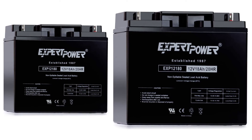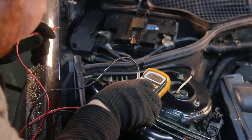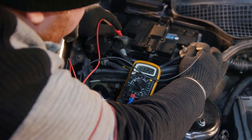If you want to monitor the battery voltage while riding, you can set a small LED voltmeter. For better battery service, don't discharge fully and keep them charged. Also, don't forget to charge them every 3 months if not in use, as that can significantly increase the battery life.